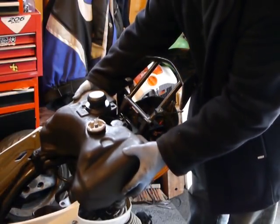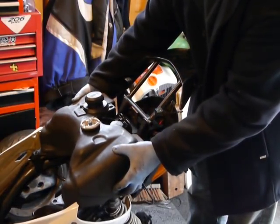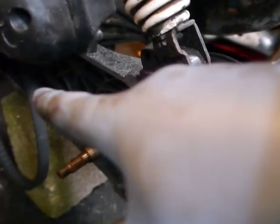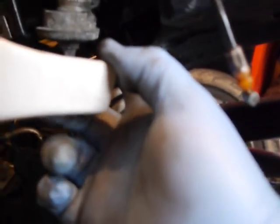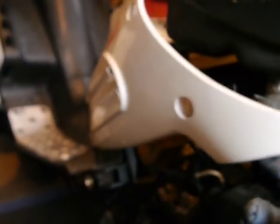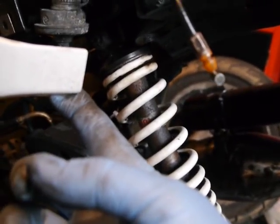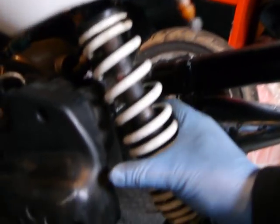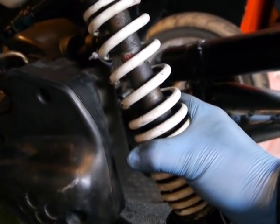We're talking about lifting this tank ever so slightly to the side. Simple for the bottom bit, but obviously support the bike — which I haven't got a centre stand, I've got a lump of concrete there. Under that bolt, that slides out, and in there is our bolt — so much easier to get to when you lift the tank ever so slightly. You'll be able to get the bolt in there. I just wanted to show you how easy it is, because if you have the whole bike still together, you're never going to get to the bolt under here. I got asked before about the rear shock — that's just a bonus feature on this one.